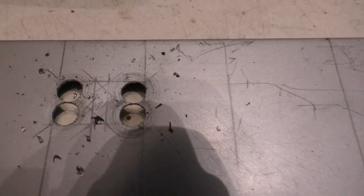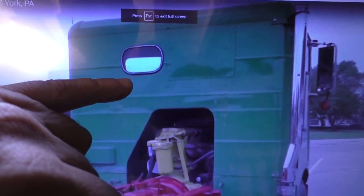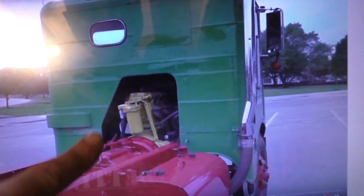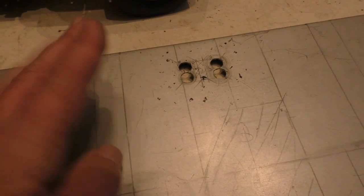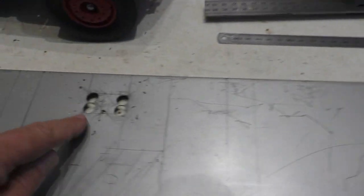Hopefully you can see the steel on the silver metal here. I started cutting and drilling out the corners for the window, and you can see where I'm going to do the same cut here. That's where my window is - I've already drilled that - and I'm about to drill holes in the sheet for where the engine opening is. I'm just going to rough it in - drill the holes but not cut these shapes out yet until after I've rolled the back of the cab. I'm using my stepper drill bits for putting these holes in.